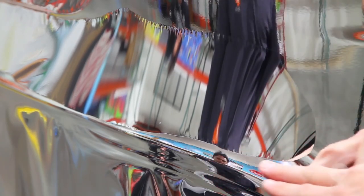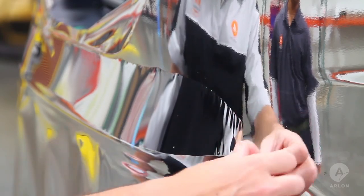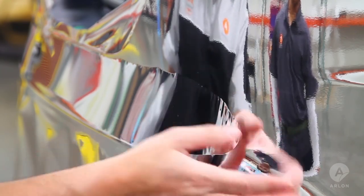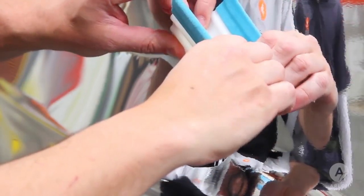As the chrome cools, the tension lines dissipate almost completely, leaving only small manageable points that can easily be worked in. Let the chrome cool completely before finishing the application. When the chrome has cooled, these small points of tension will not interfere with the smooth finish. Laying the chrome into the indentation little by little, notice that while installing Arlon's automotive grade chrome cold and under some tension, there are no adhesive lines left behind and the chrome has absolutely no curl back.